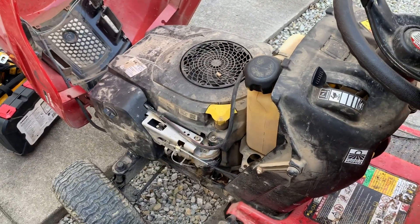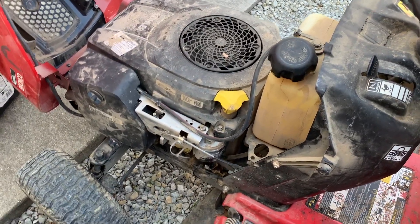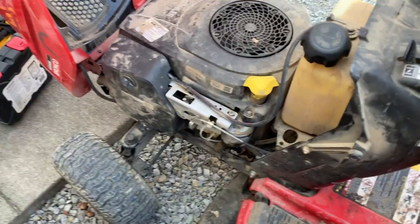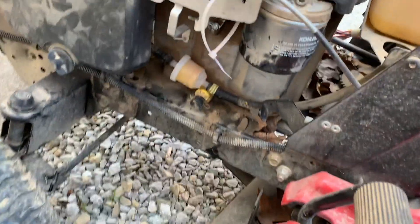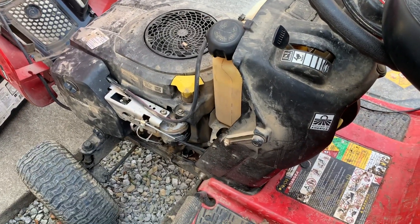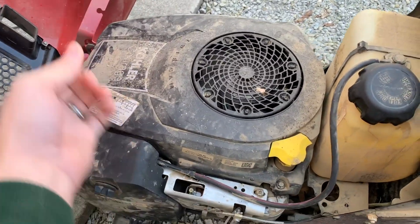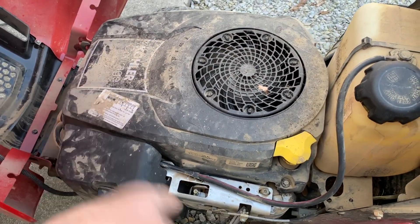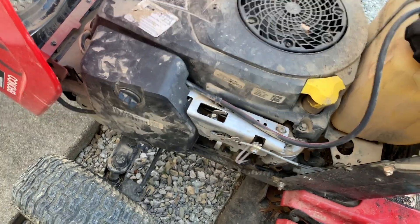I bought this from Lowe's and I think it's a carb problem, so we're going to do a carb replacement. I put in fresh gas, new air filter, everything else, and it won't stay started without starter fluid. I changed the fuel filter out - that's easy to do. It's not getting gas. I checked the spark: I pulled the spark plug out, put it on the head, it conducts, you can see it sparking. Everything else works, so it just won't start on its own.